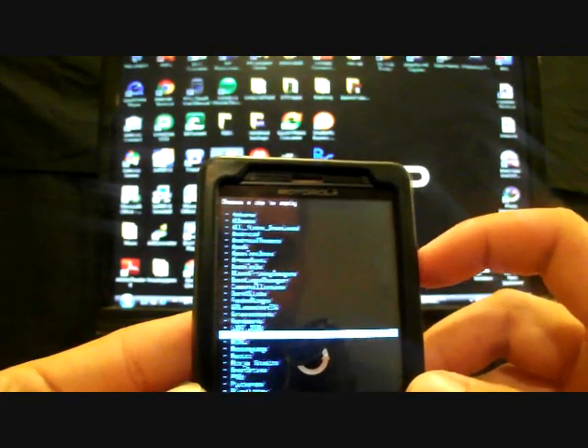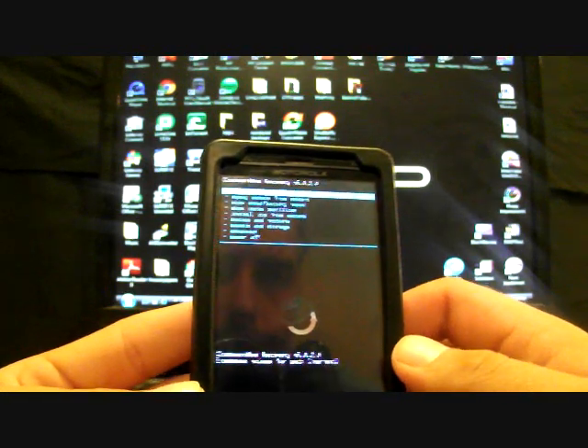If you've downloaded it directly to your phone it'll be in your download folder. I had issues downloading it directly from the MIUI server so I had to download it to my computer first and then pull it over to my downloads folder on my SD card. You'll see it there — it's MIUI.USShadow1.9.16.1. Make sure you're installing 1.9.16.1; this is the bug-fixed version. The first version released had a battery bug where it would completely drain your battery and not accept a charge. Follow the link in the description and that's the version you'll get. Go ahead and accept it, go down to yes, install MIUI.USShadow1.9.16.1. It takes about five minutes to install, and when it says finished installing zip, select reboot system now.